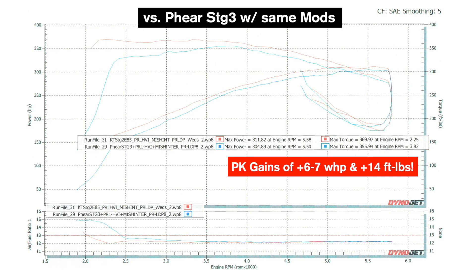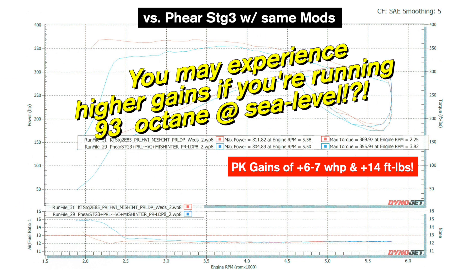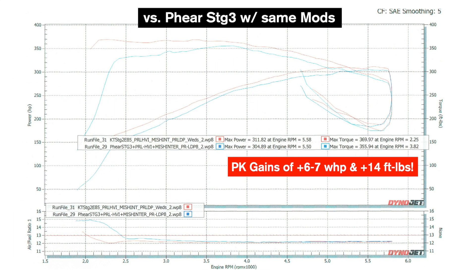Jumping to the second graph, what's really nice is you can see that we've gained in torque and horsepower across the power band. With that said, I'm surprised we didn't gain more. I think in part that may have to do with the restriction I have on our octane level — I only have access to 91 octane. Also, I am at high altitude with less oxygen, putting somewhat of a limitation on how much we can get out of this tune.